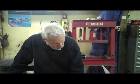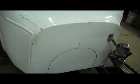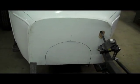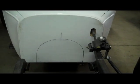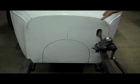Now, something that we don't do in the kit, but we give you the ability to do, is that we mark the front of the body where it needs to be cut out for the transmission that comes into it. Just follow the cut point, use a reciprocating saw and cut that out, and you have your location inside the transmission tunnel for the transmission to go into.